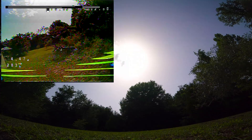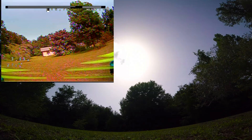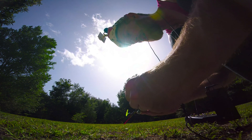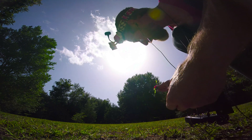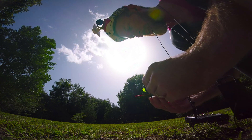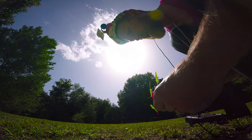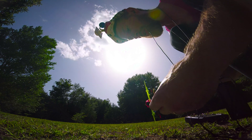I think my battery is about done - I wasn't really paying attention to the time. I'm way over two and a half minutes, which is what I usually get out of just about any battery for this size quad. Motors aren't hot - back ones are a little warmer than the front, but nothing. I can hold my fingers on them all day, and I was hitting it hard. Testing to see if the voltage spikes might kill this board - that was a pretty hard flight and it took it like a champ. Good job GepRC. We'll see how it goes - I'll keep y'all up to date on the gnarly FPV Primo quad.